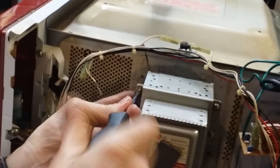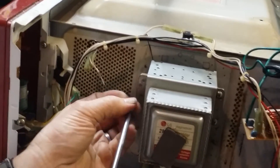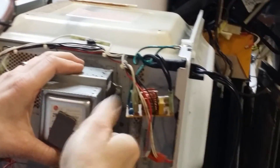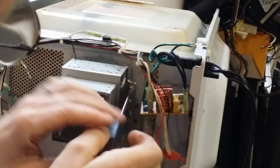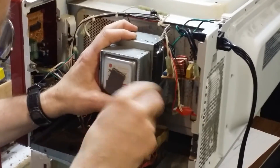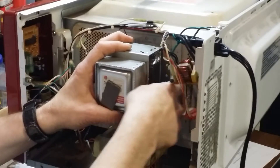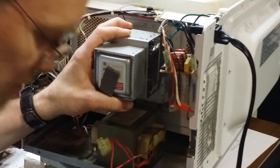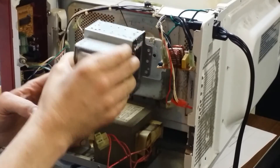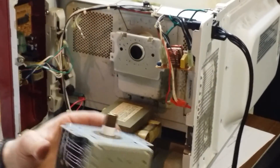There's nothing hazardous on the magnetron itself other than possibly some sharp sheet metal spots, so as long as you take care of how you handle it, the magnetron can't really hurt you. But it is delicate, and you'll need to take care once you take the last screw out that it doesn't fall or drop, and that you don't bang the antenna against something when you take it out. Usually you can pull it straight back, or in some cases there may be a little tab that it hangs from. There's the magnetron right there. Now we're ready to set this aside and put it in the unit we're going to repair.